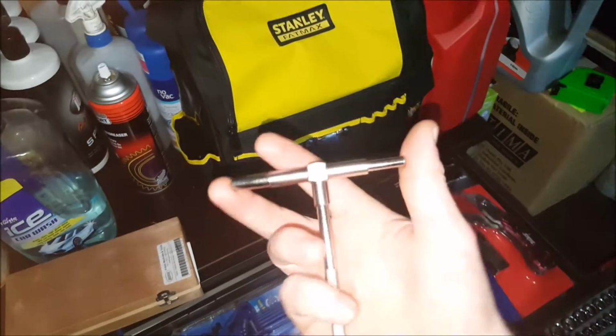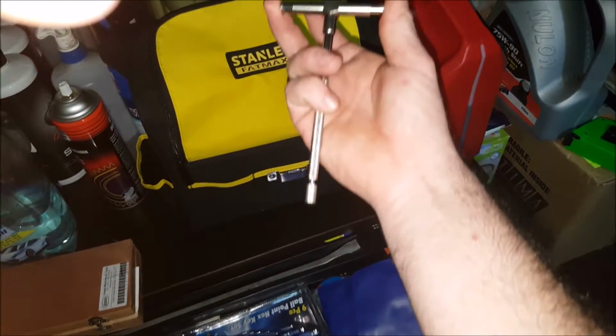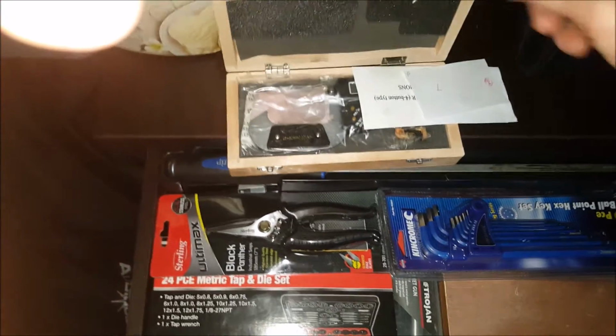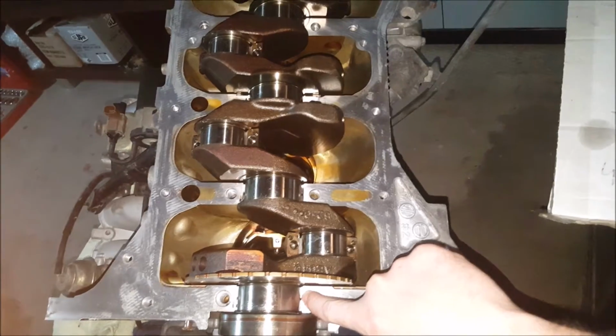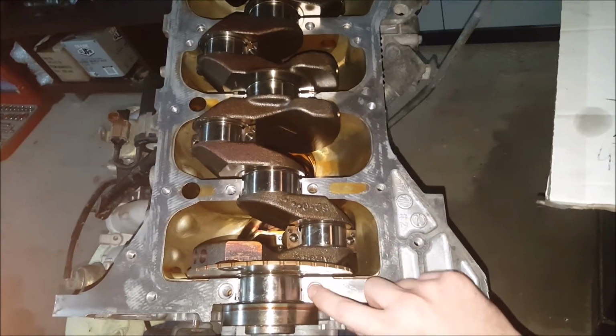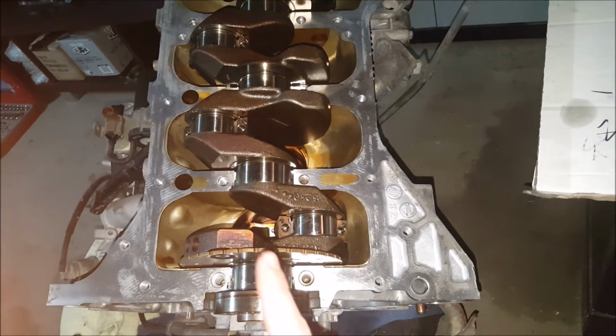So what you do is close that up, let it expand in your hole, tighten it up at the bottom there, that'll stay still, and then you measure it inside your micrometer. Them two measurements will give you your crank outside diameter and your hole inside diameter. So you minus the crank outside diameter from the hole inside diameter. That'll give you your bearing clearance. So from there you can go to your graphs, figure out what bearings you need.